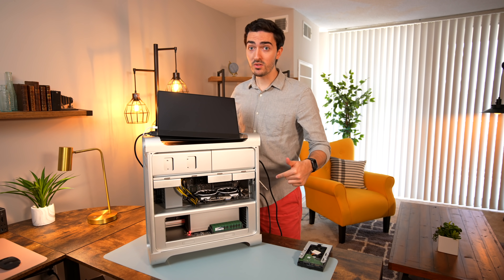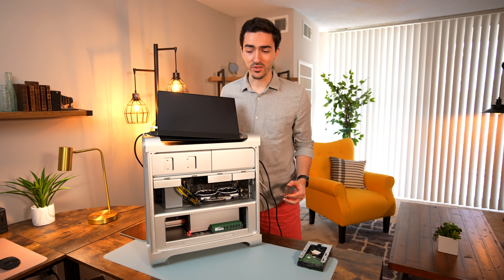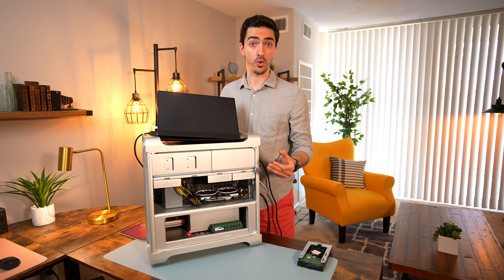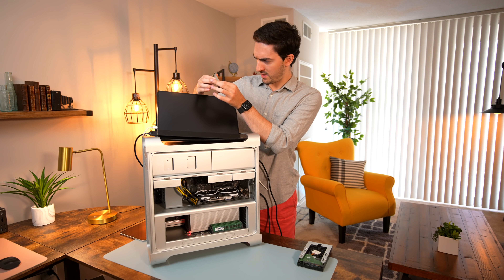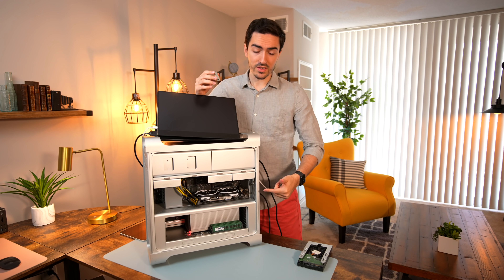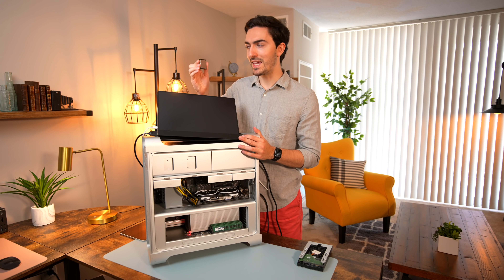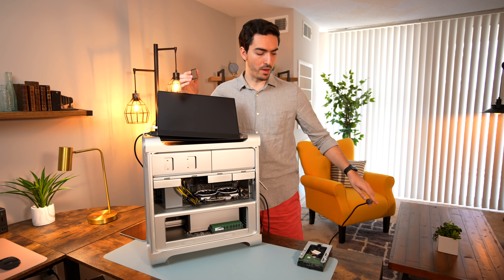There's a red unblinking light on the CPU tray. Apparently, the dual CPU trays have a red LED for each processor, which lets you isolate which one had failed — but we only have one processor, therefore one light. The fact that there would be two LEDs for two processors definitely indicates a CPU issue rather than RAM. Fortunately, that's pretty easy to fix on these machines because the CPU tray slides out and the CPUs are crazy cheap — like insanely cheap.